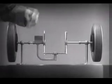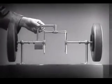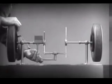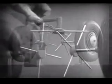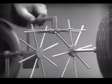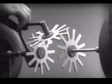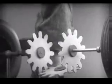As long as both wheels are free to turn, the bars do not swing on their pivot and the wheels move at the same speed. Now we have the working principles of a differential. To adapt the model for use in an automobile, we will have to make a few changes. In order to reduce the jerky action caused by wide spaces between the spokes, we will put in more spokes. Further filling in the spaces between the spokes gives steadier, more continuous action, and changing the shape gives firm, constant contact.